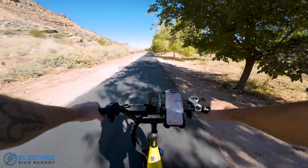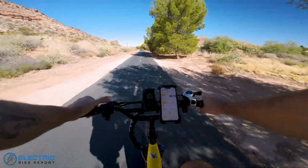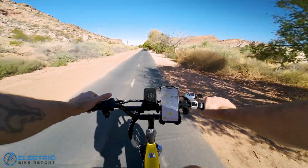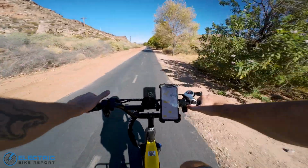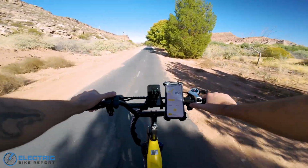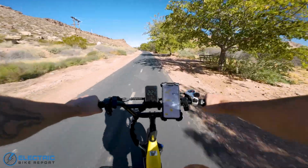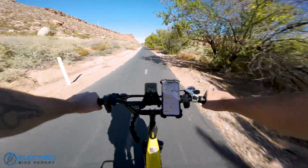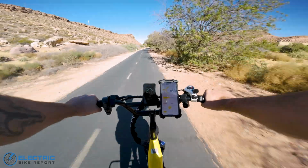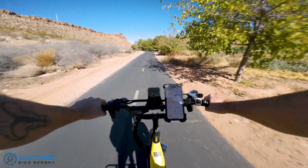All right, we are back for a Class 3 speed test here with the app paired to the bike. So start things off kind of in the same place in PAS1, right around 10 miles per hour. Let's go ahead and go up to 2. All right, that puts us at kind of about that same 13.5, maybe 14-ish miles per hour in PAS2. And then, all right, let's see what happens in PAS3. I think we're just gonna kind of take off like a rocket here. Yep, that's exactly what's happening. I am ghost pedaling now above 20. So just basically spinning the cranks freely up to 27, 28. All right, yeah, we are hitting that Class 3 limit. So we will call it there.